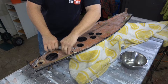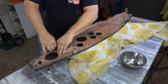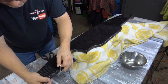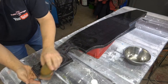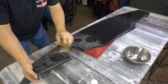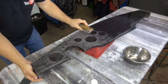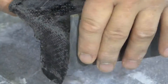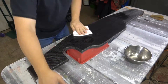The next day, start working on the back side. Work on a soft surface and cut away all the excess material from the back. Remove all the tape you may have put on and focus on the corners — any loose fibers need to be removed. With 120 grit sandpaper, sand the entire surface to make sure there are no high spots and get rid of any defects. Also get the corners and make sure they are shaped with no extra fibers to look exactly how you want them. Wipe down the entire surface with isopropyl alcohol.